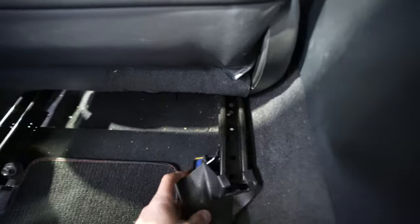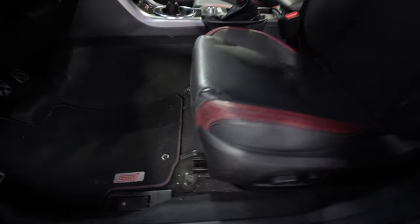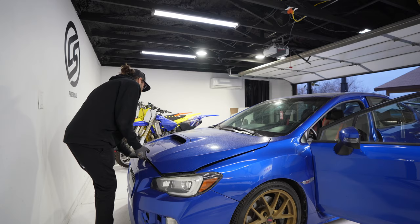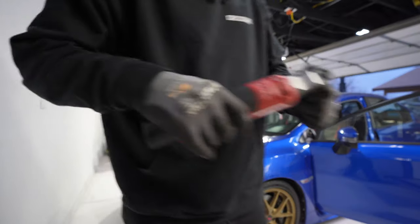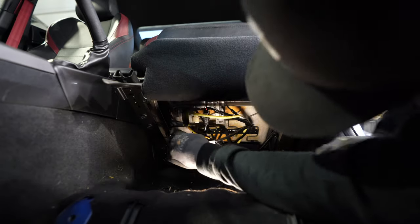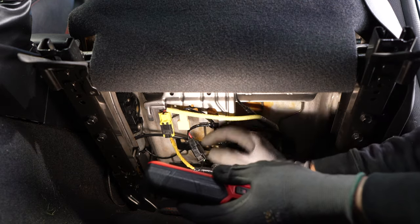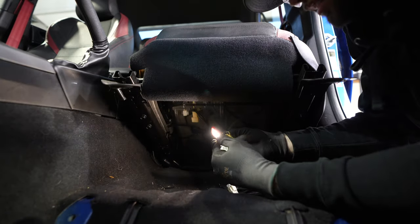Pull that off gently. Grab yourself a 14mm. Scoot that front seat all the way back. Now we can see underneath. Battery disconnected since we're messing with airbags — check. That one slid off, that one has a push pin. Black one slides off too. The white middle one, I just pushed it out of that connector. And the yellow one slid off too. So these all just slide off — now it's easier to access these to disconnect them.